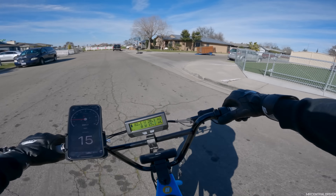We're back and I did check with the GPS — it says we hit 43.6 miles per hour. It's not bad on this setup. I know you guys want more range and torque, but this is everything working on the stock motor, which is why I did this build — a lot of people do not want to move to bigger motors and have to change everything out, getting a lot more expensive. This is a very nice clean setup. The battery looks awesome on here, you have an indicator right there — obviously upside down because I had to flip it to get the wires connected, but it does tell you the battery percent. To do this setup you need a Phase Runner to replace the stock controller — here it is, very small, little red light because it's still on.